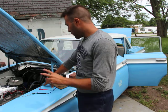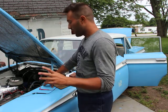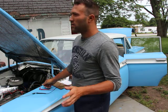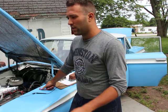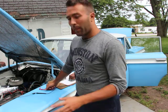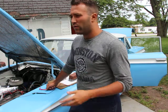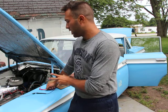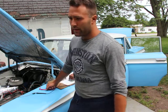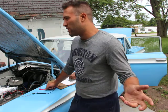Now, when the car was on, I was getting 12.6 volts, which, if you think the system is 12 volts, if it's operating at 12 volts, good. Not really, because of the voltage drop. We should have about 3 or 4 volts of voltage drop. So the actual voltage that you should be getting at the battery is about 14 volts, and that depends on temperature and